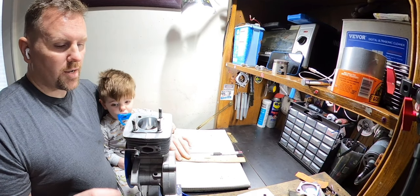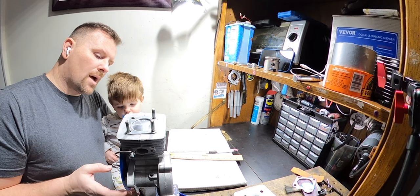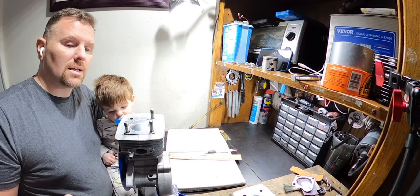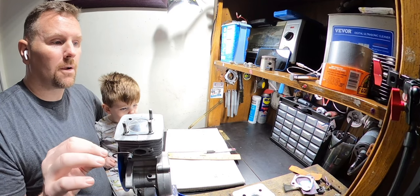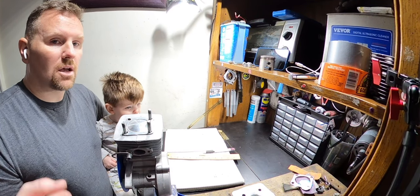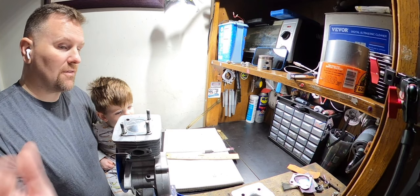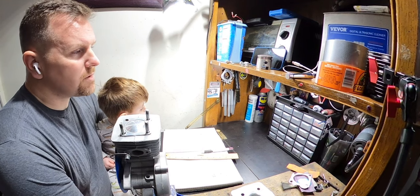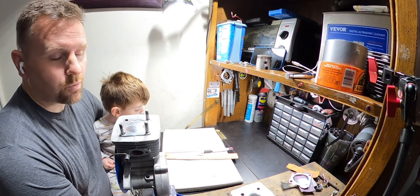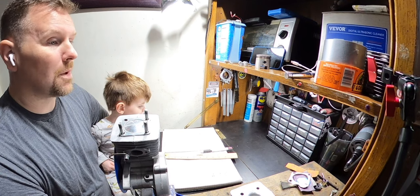To get the squish right, I cut the top. The big issue I was going to be worried about was free porting. Basically, having the exhaust port open to atmosphere for about 6 degrees of duration at TDC would have basically been an air leak, like introducing an air leak into your motor. Very minimal amounts like this would have probably not even been noticeable.